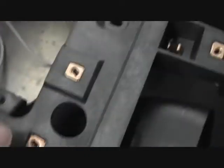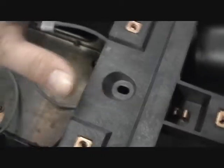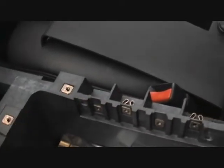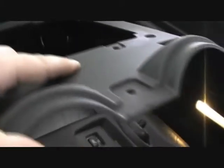So once you get that center console piece, there are two screws right here, two screws in the back, one right here, and two more screws here and here, that give you the ability to remove this piece, which is pretty much your entire fascia for the center console, all the way from front to back. You can see the two hoops where the back air vents go into.